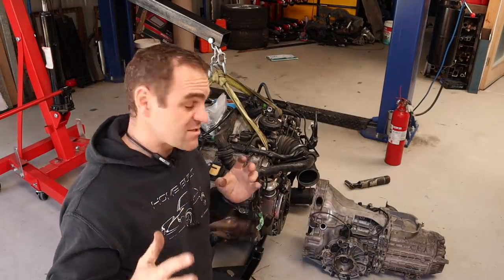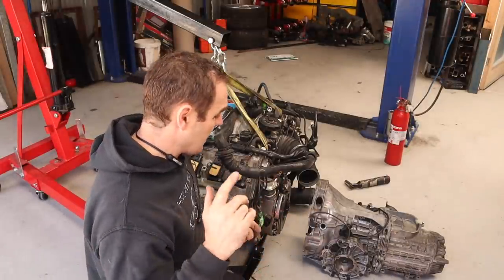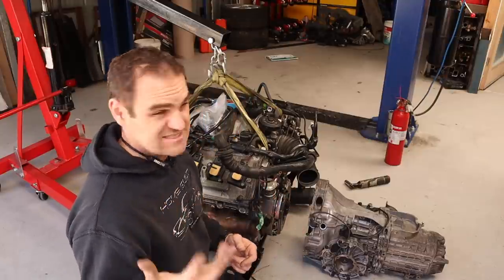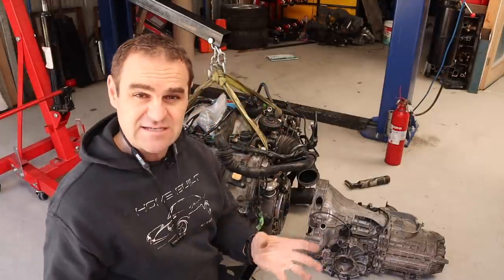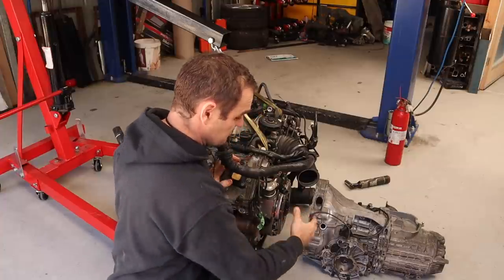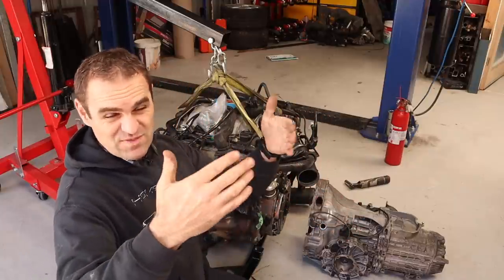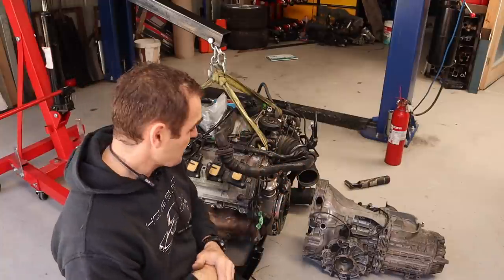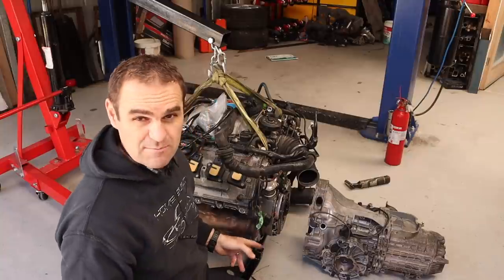For those of you who missed it last week, I was going through and connecting up a new clutch and flywheel to the Audi engine and mated it up with the factory gearbox. I'm still waiting on a few bits and pieces — the clutch came with seven flywheel bolts, not eight, so I need to get another set of eight. I also need a spacer, which is a factory part used on some of the 2.7 engines from the early 2000s. It goes between the bell housing and the block, spacing the transmission back a little further, which will push the gear shift cables about five mil further back. The front cradle is solid — it's pushing the gearbox back, not the cradle forward. The engine's not going anywhere.